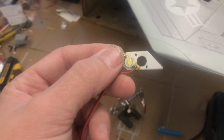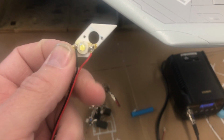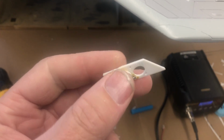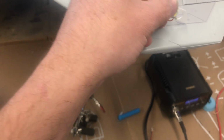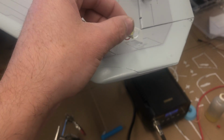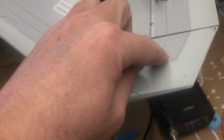So if you have any questions, this is really easy to do. It's better than what our original idea was. We made it perfect. I think it works a lot better, and your lenses are going to be great. And then you just remember, you can go to Home Depot. They can color match every one of these paint colors. What I do is I use a piece of aluminum tape. I cover the lens, smoothen it down, and then I cut it with a razor blade, paint everything, and then I peel the aluminum back off. And that'll cover everything up.